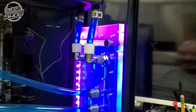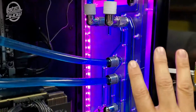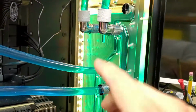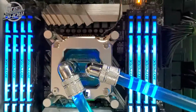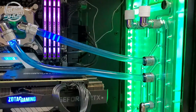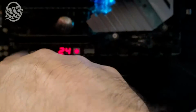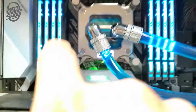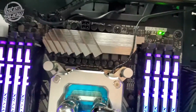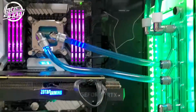and there's the RGB lighting, if you guys can see it. It's 5 volts. I can't control it. It's not set for a motherboard or anything like that unless I had the actual 3 pins on the motherboard. Unfortunately, this motherboard only has the 12 volt pins, but if you can see it, my Christmas tree is lit up. There's 1 connection here that I have, an extra one, and that one's it, and that's about it. I don't have any other connections in here, but it looks like everything's turning on like a Christmas tree, like it's supposed to. You can see the front.